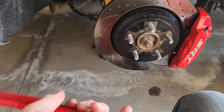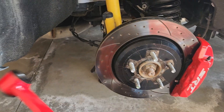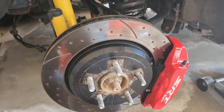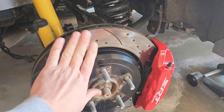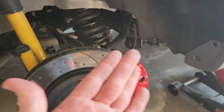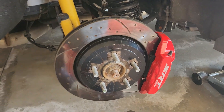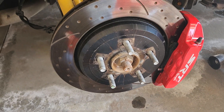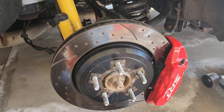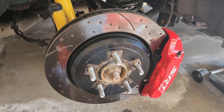It's funny — after I bought the Eibach springs, got them installed, let them settle for a bit, I took it to my friend's alignment shop. We aligned it and the camber is way off on the rear end — the tires are squatting and leaning pretty bad towards the inside, towards the upper part. So I went to the Eibach website, and sure enough, guess what they have now? Adjustable control arms — I think they're getting some complaints about the camber being way off.